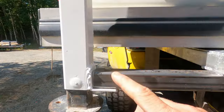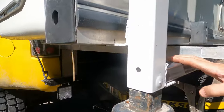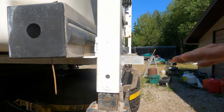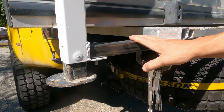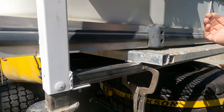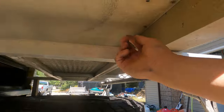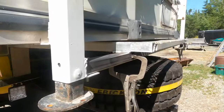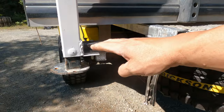I have some angle iron brackets welded to the jack outer tubings that support my crossbar here. I also previously welded some other angle irons to support the rear bumper and make it really rigid. That's going to be good here because I'm going to get some of my strength from the rear bumper to support the deck when it's out. The down force is going to go on the crossbar; the up force is going to go into the bumper. I'm going to try to get my support off of the bumper.